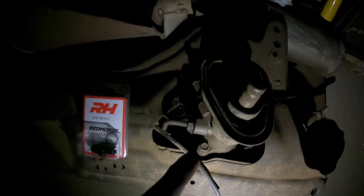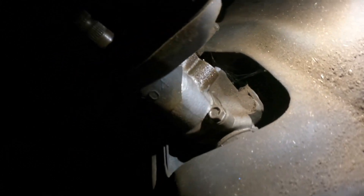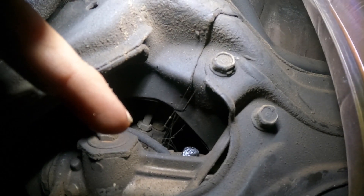The car is kind of low and I want to go a little bit lower, so I really want to eliminate all hoses under the car. I think the only issue will be the brake lines, but for power steering and eventually fuel, hoses are gonna be ran inside the car. This is the adapter for the high-pressure side - I have an extra EK subframe and it's gonna go right here. I already took it off just to test it, but just make sure you put that washer on first. I want to show you guys how it looks outside the car because it's really compact under the car - I have an adapter going to that little hard line.